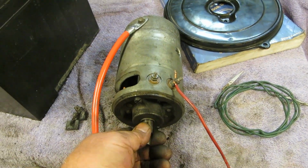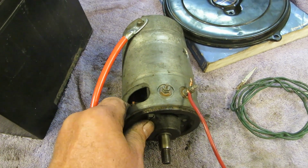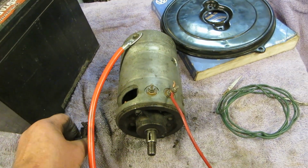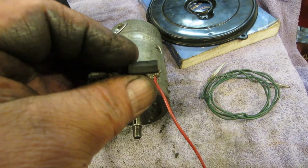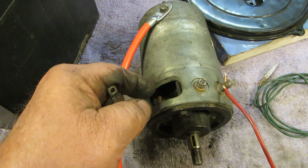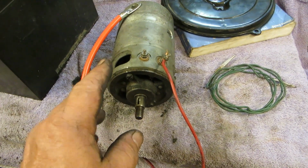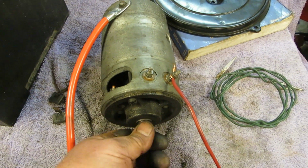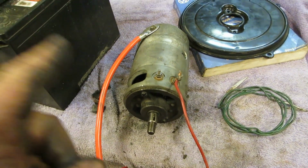Okay, I am wrong. It does turn clockwise. But that noise is the brushes, because I can pull the springs back and it doesn't make any noise at all. My thoughts on this are: if you look at those brushes, they're worn and they're just used to running on that commutator. These brushes are straight and they're clicking on the edges of that commutator. So it'll take a little bit, but it'll stop making that noise after a while. Okay, see you guys later.